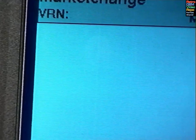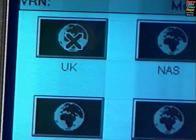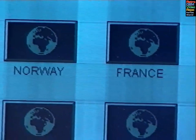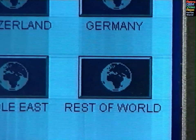The BeCM can be configured for many market setups, each employing features required for that country. The Swedish specification, for example, has daytime running lights, which can be selected within the BeCM using Testbook. A word of caution about this market programming ability. While some changes, such as the running lights, are visible, other changes may not be so obvious. Systems such as security, locking, and windows may be altered with changes of market without you realizing it. Now, this could cause annoyance to the customer and in some instances could make the car illegal in some markets.